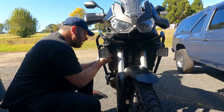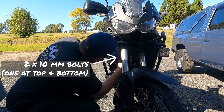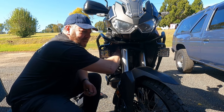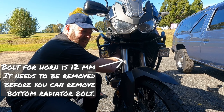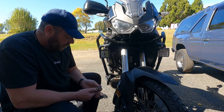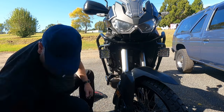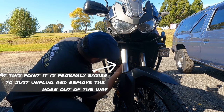There's a screw from the side of the radiator which holds this plastic shroud in place. All the bolts that hold the radiator are 10mm and there are four of those in total — two each side. The bolt that holds the horn in place looks to be a 12mm. So you will want a 10mm socket and a 12mm socket. Then once your horn moves out of the way, back to the 10mm socket to remove the bottom radiator bolt.